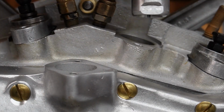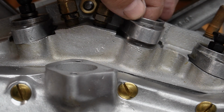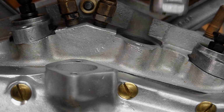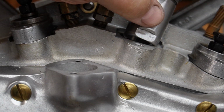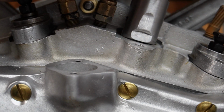But watch this now. Okay, remember I had to knock that in with the hammer a little bit. Look at it now. In and out, no problem. So putting a little relief where that slight hump must be on the inside fixed the problem.